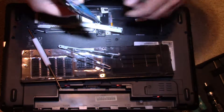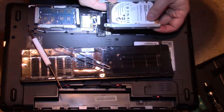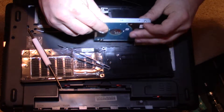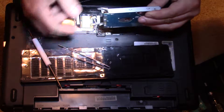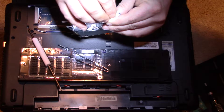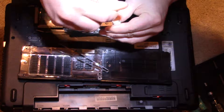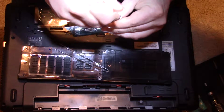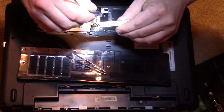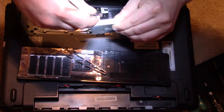Installation is the reverse of removal. Remember this goes in like this — that's going to be the top, going into the cage. You can look down and verify the ends just to make sure before you start screwing. Make sure your holes line up when you put the cage on. Getting these little screws to line up without falling off may be the most difficult part. Also, you want to try not to use any magnetic devices when dealing with hard drives — it can really damage them. So while a magnetic screwdriver would be handy with these screws, don't use one.